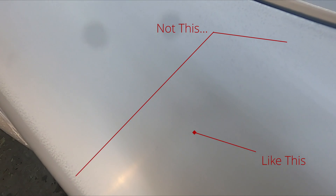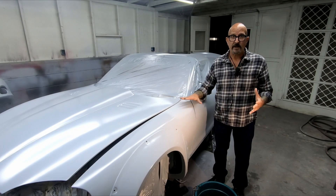Here's our original, as-sprayed, textured orange-peely surface. As we sand into that, we start to see more dots — those dots are the low spots. We want to keep sanding those until they all go away and the whole surface is just a uniform finish like this. All we have to do now is make the whole car look like that.